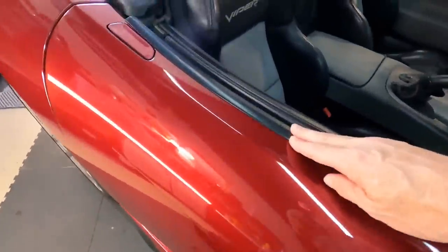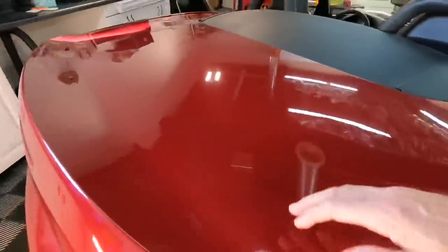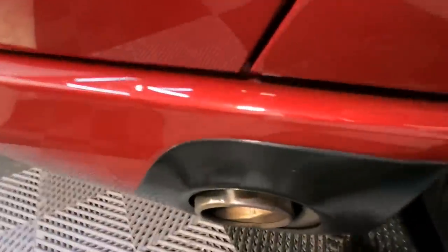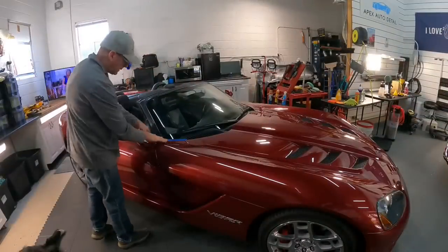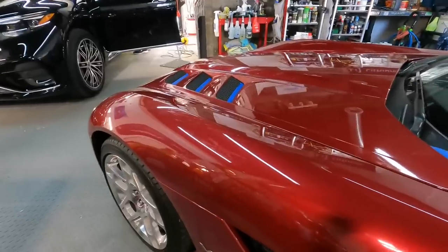The next thing on our list is to protect rubber grommets, trim, any type of vinyl, anything we don't want the backing plate or the pad to bump up against, or even get some polish splatter to discolor it. Masking tape, quick and easy. You don't have to tape up the vehicle like we're painting the car. Just protect some of the areas that are vulnerable, just like this.